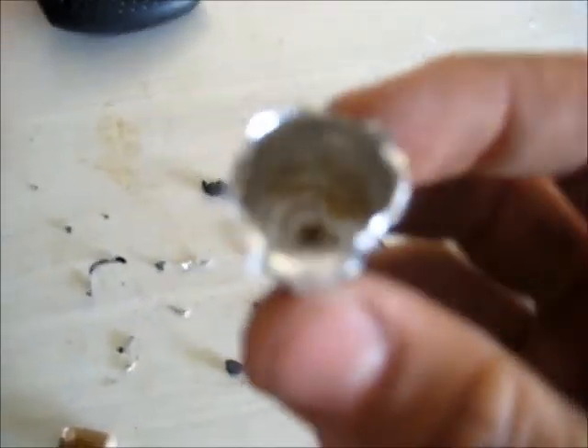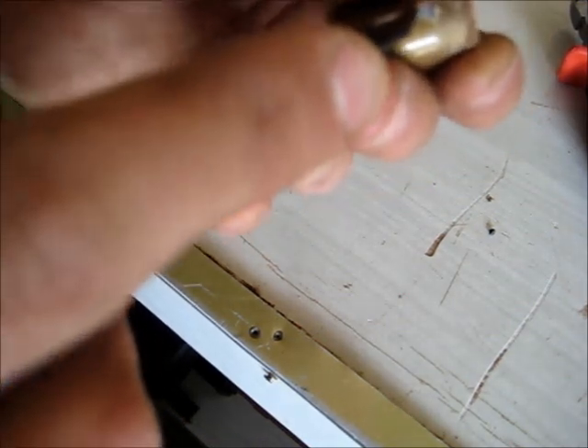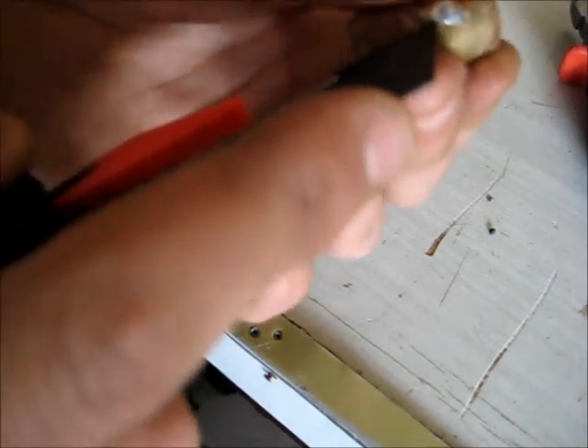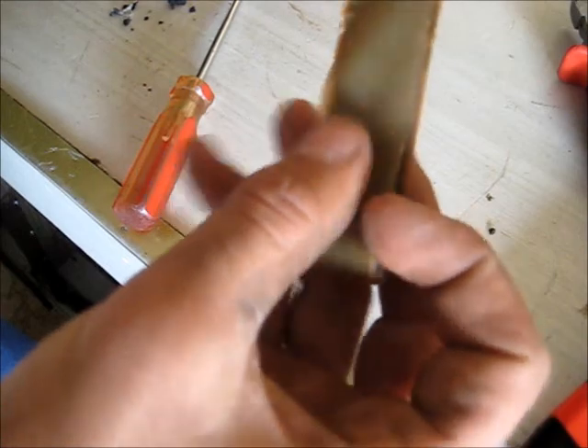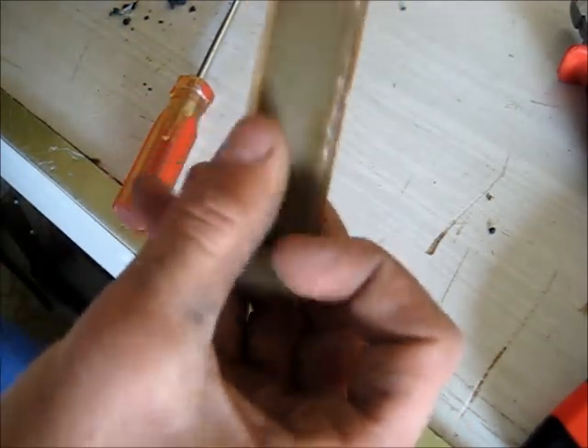Just snipped all the crimp off and you can see the vent and all the guts inside have popped out of that vent. You can see it's kind of bulged. Here's the actual stuff itself — it's all dried out, and it just smells like crap, doesn't even smell like a proper formula. There's a bit of tape there — I'm going to cut that tape and just unroll that to see what sort of damage we've done. There's a foil — one's positive and one's negative — and there's bits of paper that are dielectric, and this is all soaked in the electrolyte.